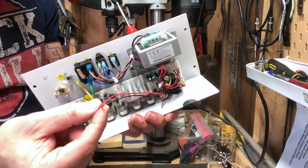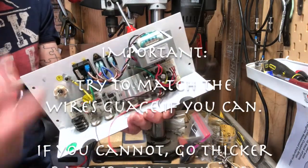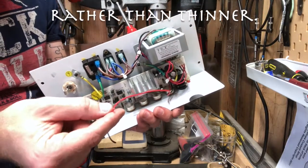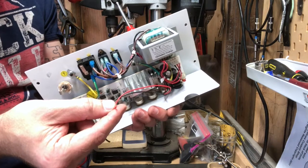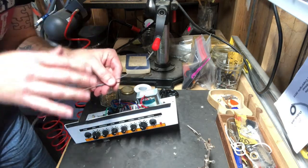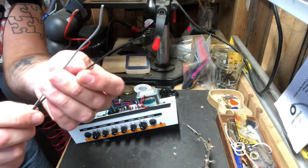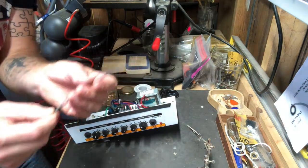Larger meaning a smaller number, but larger around. So if this was 18-gauge wire, you could go to 16-gauge, but you wouldn't want to go to 20-gauge. I went through my box of wires and unfortunately I didn't have a red and black in the right gauge, but I do have a gray and a black. So I'll use the gray to the red and the black for the black. And there we have our two wires.